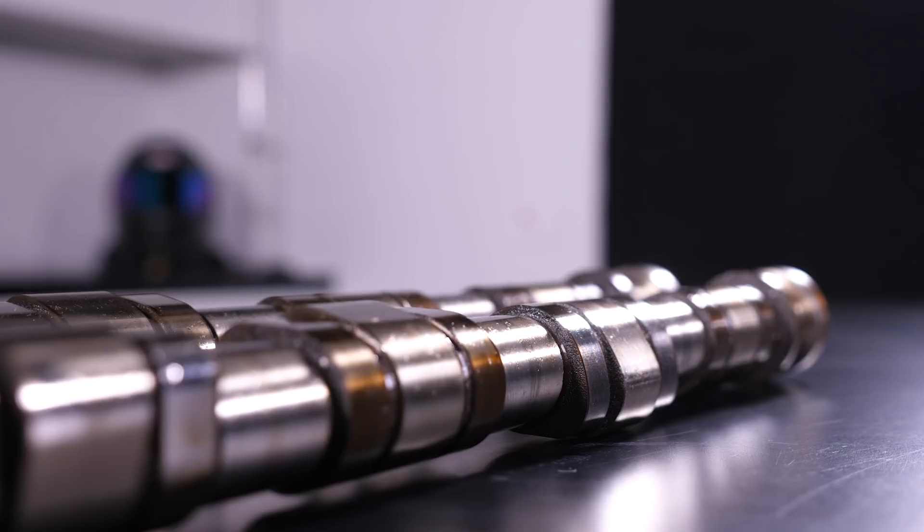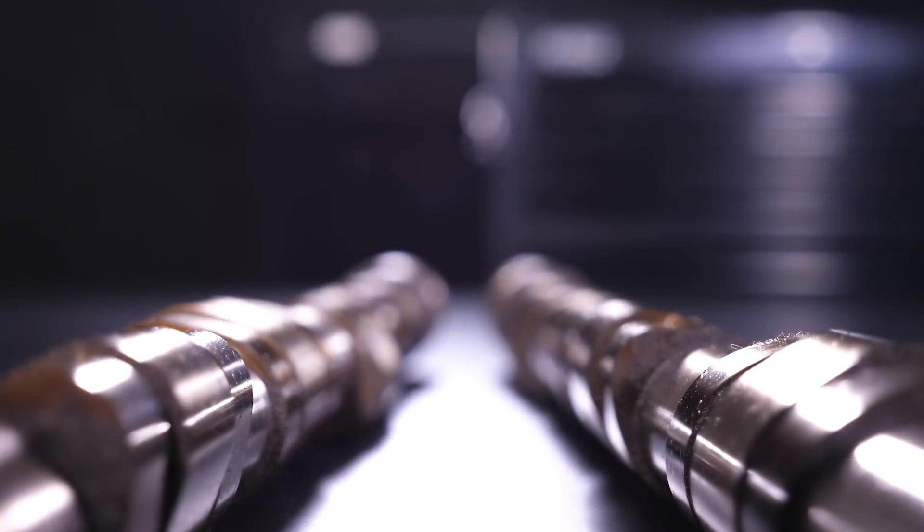The difference between naturally aspirated and turbocharged is that the turbocharger typically results in higher exhaust manifold back pressure — this is pressure measured between the turbine inlet and the exhaust valves. This can work against us if we have a lot of overlap. If the exhaust and intake valves are open at the same time and we've got very high exhaust manifold back pressure, this can tend to dilute the intake charge with burned exhaust gases, which isn't going to help our quest for power. So when selecting a cam profile we need to be mindful of our application, the power and RPM range we want, and the exhaust manifold pressure we're expecting.